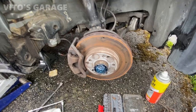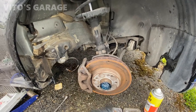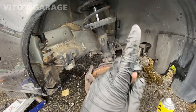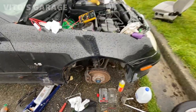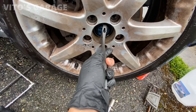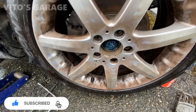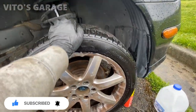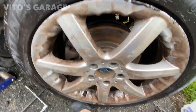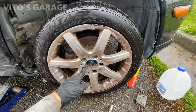I got the cap off. I'm going to adjust this bearing by putting the wheel back on — if you haven't watched my videos on how to adjust the wheel bearings on these machines, the link is going to be up here. Just to the point where the play is gone in the wheel. Now it's gone — awesome. Now I'm going to take the wheel off and tighten that.